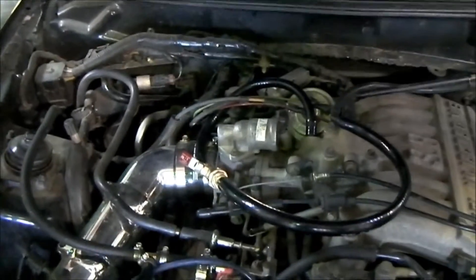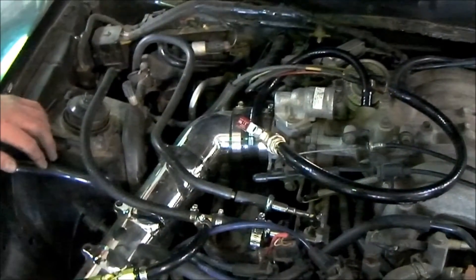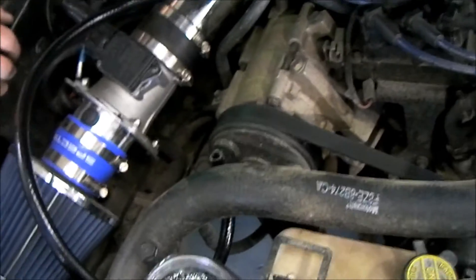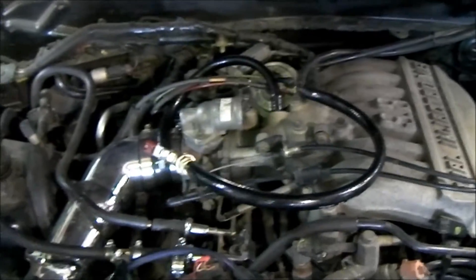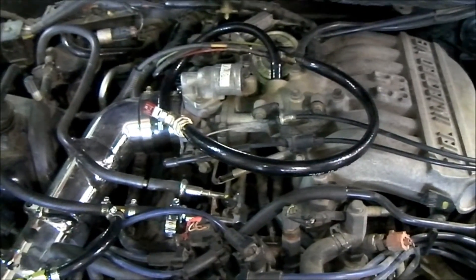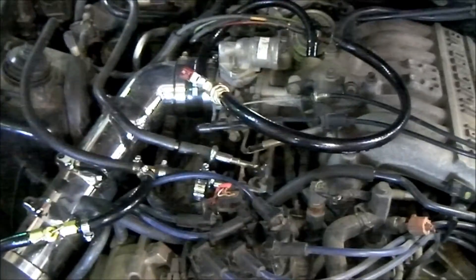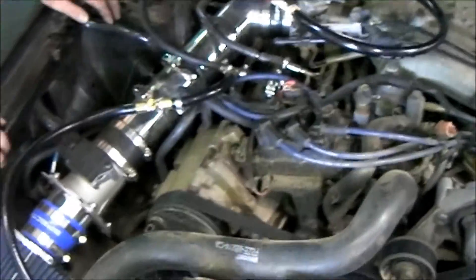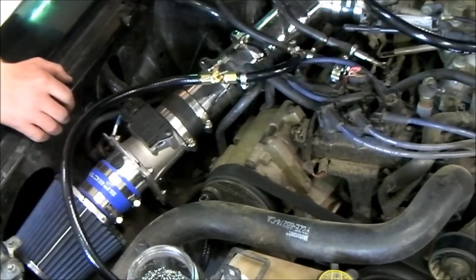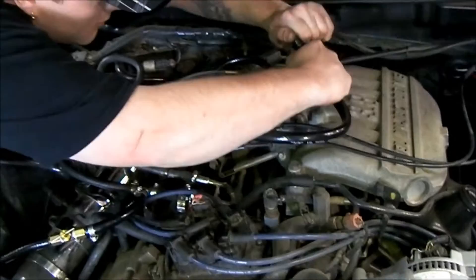Here's the thing — the reason they run a line through the PCV valve is because that is almost like a metered vacuum leak. They're using that line to draw fumes out, because the computer is calibrated to see some airflow through that PCV line. If you set up another line introducing air into the engine, that's going to throw off your idle. So you ought to hook this up through the PCV line — especially since you're trying to determine if this is going to work as a fuel saving device. The object is to do it like you see people doing it on YouTube so you can prove them right or wrong. You're off to a good start, it's just kind of hard to get to your PCV spot back there.